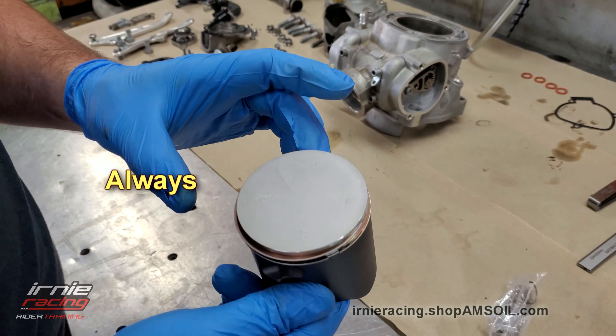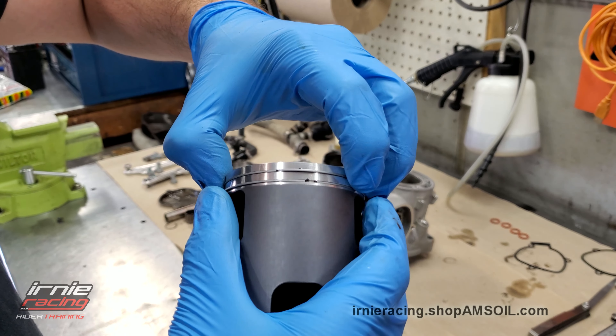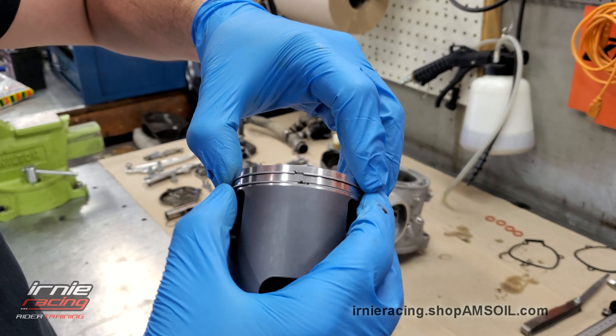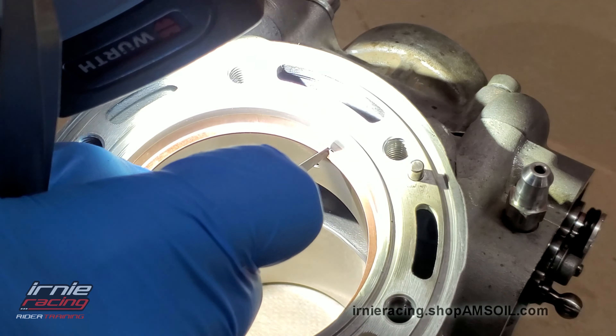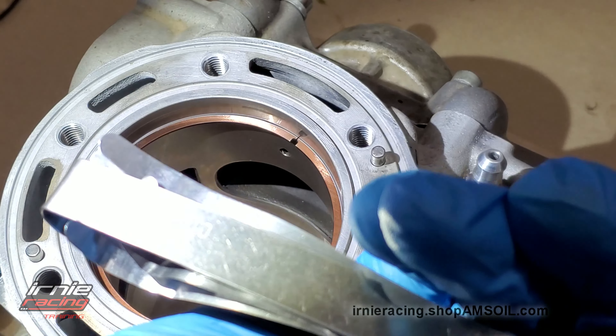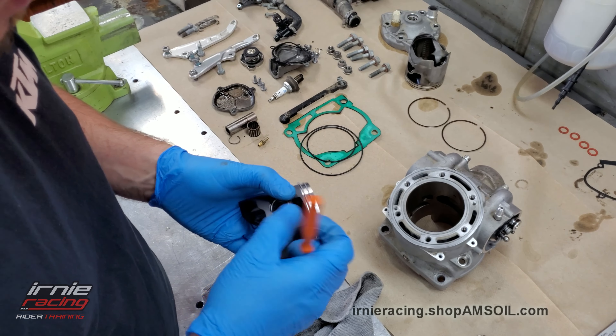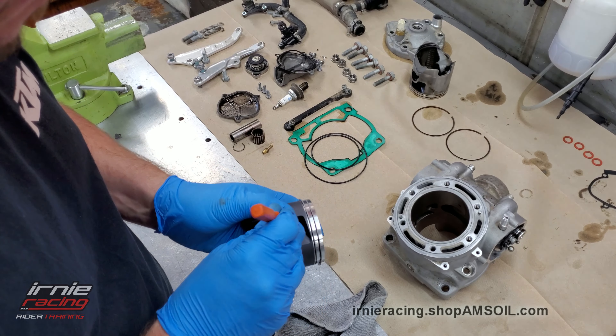New OEM piston. See those little pins there? That's when you assemble it - if you do it wrong, it's not going to fit. So that's basically 0.3mm - nice and tight. Some people say wear eye protection for that - they're pretty tight, they could shoot at you.